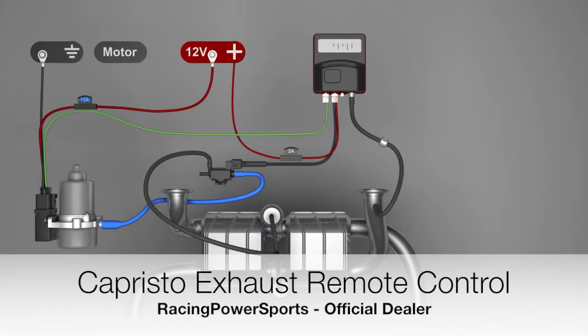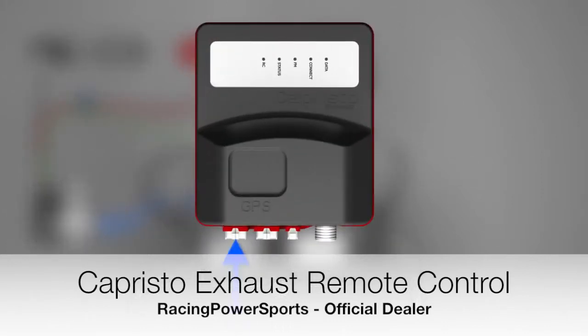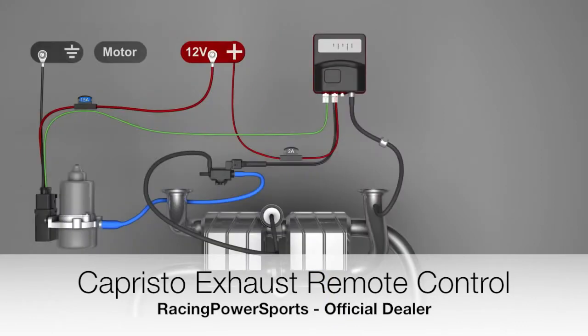When the car does not have a back pressure connection, an extra vacuum pump is installed which will deliver the required back pressure to the exhaust valves. The socket can be used either for the solenoid valve or for the vacuum pump, but not for both. The middle socket is a dedicated solenoid connector and at the same time serves as a power supply. The right socket has the antenna cable which sends the RDS information to the car radio, and is also the ground wire for the power supply. At the very right is the connection for the back pressure hose leading to the exhaust system. This back pressure hose has a ventilation valve which ventilates the hose when the gas pedal is released.